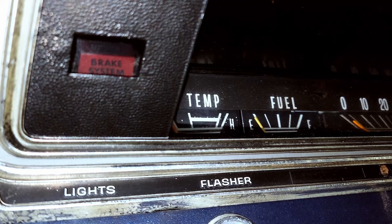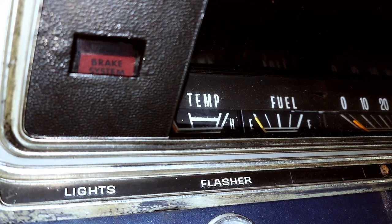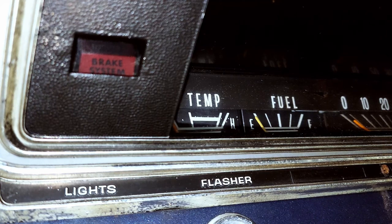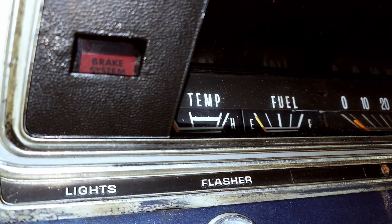Our gauge is still not working. Here's what we know: we've got good voltage into the gauge, good voltage out of the gauge, and good voltage back at the tank — but gauge still no worky worky. That leads me to believe that the gauge itself is bad. I was pretty excited when I saw voltage back at the tank, but when the gauge still didn't work, it was kind of a bummer. That's the way it goes.